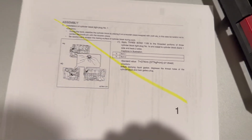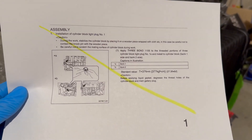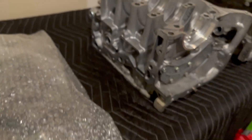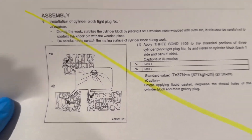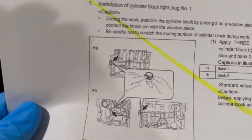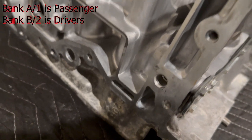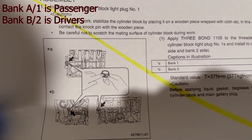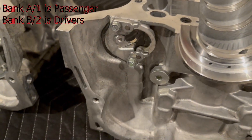The first page is actually near the end of the manual — I'll link the fully organized manual in the description so it's easy to find. I checked to verify all the plugs are on here: there's one there, one that would be here but I took it out because that's where the oil feed line for the turbo goes, and one right here. This picture also helps you identify which block half is bank one and which is bank two. You can see the alignment holes and that's how you determine which is which.